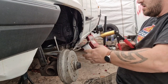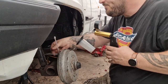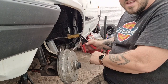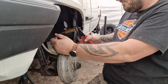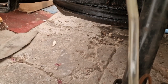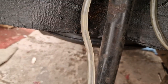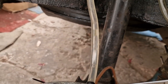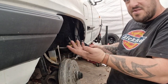It's always a flow of air bubbles even when it's working properly, which is really confusing. Why is that not building pressure? There we go. Look, you can still see air coming out, going into the bottle. Pressure's going down but there's always still air bubbles no matter what I do. But then if I was to jump in the vehicle and pump the brake, there would be no air bubbles. It's this machine — you can never bloody tell. I actually need somebody here to help me do it, to sit in the car and do it old school style. I prefer that because you get a decent reading.